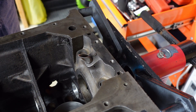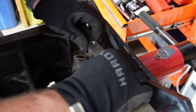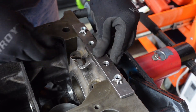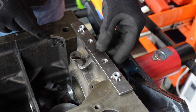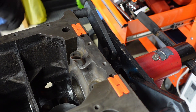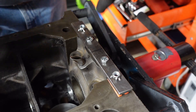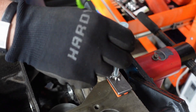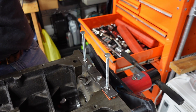Back with the motor now. I got the bearing cap in, screwed it all the way down, and tightened it — didn't torque it, but tightened it — then took the bolts back out. This bearing cap is in there and you can rock it a little bit, but it's not as easy as the other two to just lift out. That's where this tool comes in. I'm going to put something under here to protect the seating surface so I don't mar it with the bolts as I tighten down. I'll use these plastic razor blades for that. I'll alternate tightening the bolts so the bearing comes out straight, otherwise it'll bind.